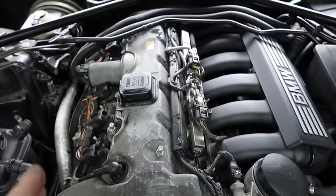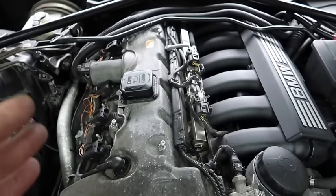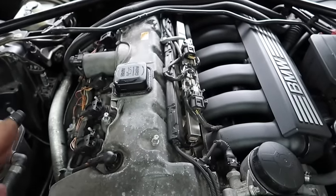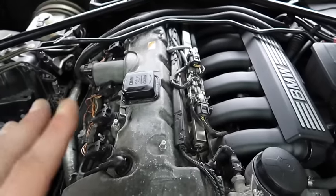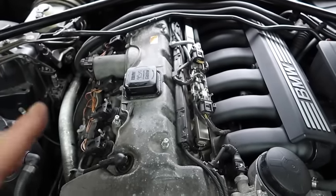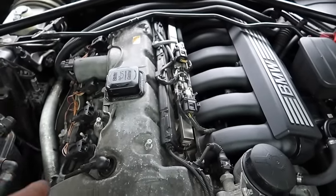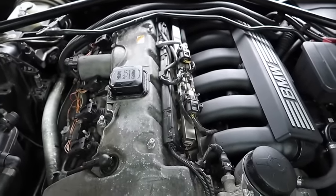Change your oil viscosity — 5W30 is fine up to 100,000 miles, but as these engines get older with more mileage, 5W40 is the best way to protect the engine internals. They're getting older and need more protection. I completely recommend 5W40 for these M52 engines. Do not go by what BMW state on 5W30 — it's too thin and that's why your engine is drinking oil very quickly. I hope this has cleared things up for you guys who keep asking why your M52 is burning oil and how to fix it.